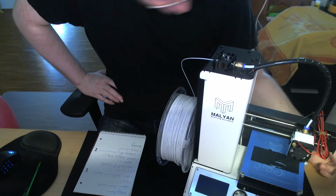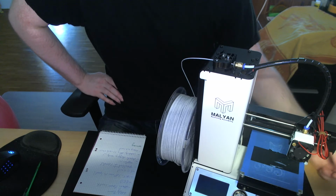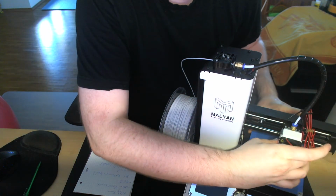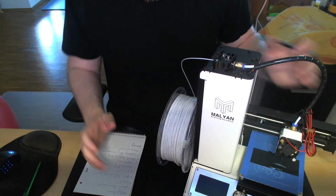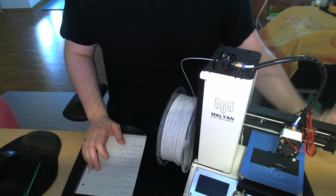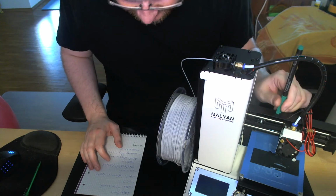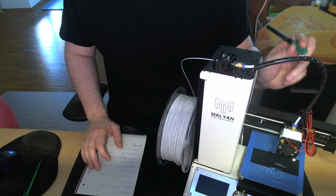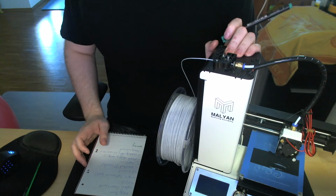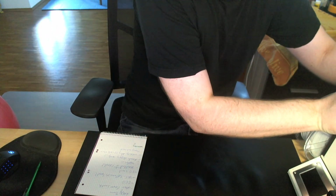And the next thing it has suddenly now, I don't know why, it stops printing. But it doesn't turn down to the start menu. So suddenly, it's all moving, and suddenly, freeze. Actually, not freeze. You can press the cancel button, but nothing will happen. The heat bed will stay on, the extruder will stay on temperature, and that's not really nice concerning safety, which is actually quite a topic in 3D printing, I've heard so far. Yes, that may be a new problem or simply just a software issue. I haven't figured out a solution for that yet. So that's the ranting. Woo, about 10 minutes.